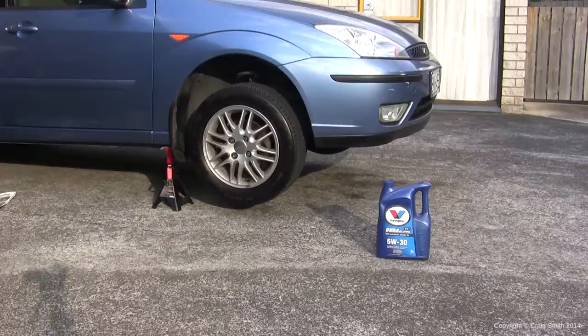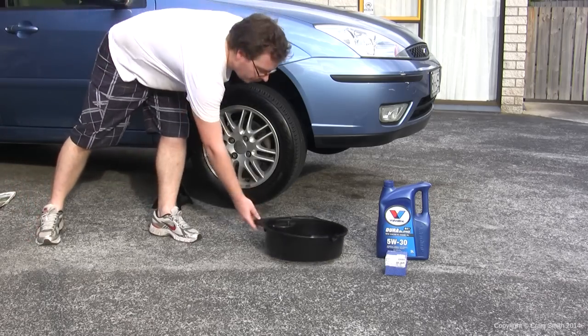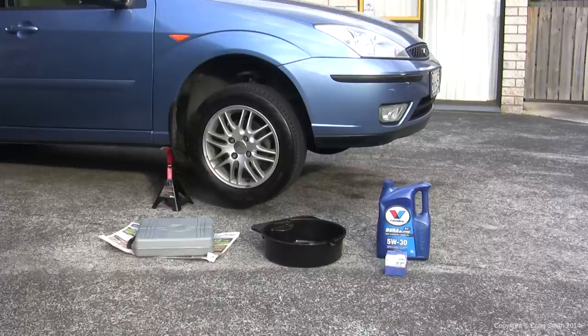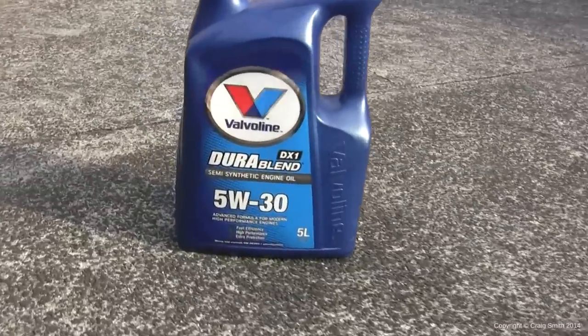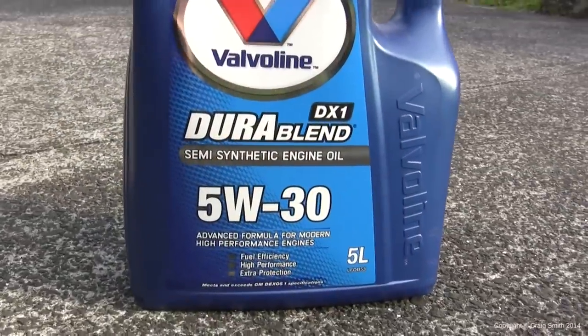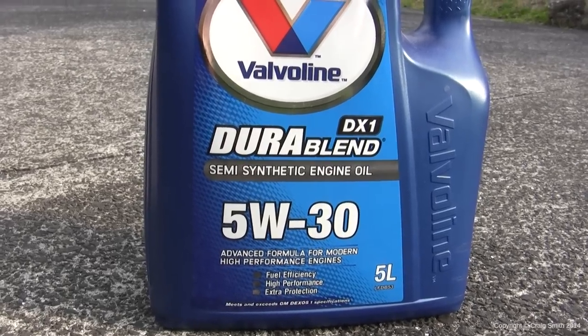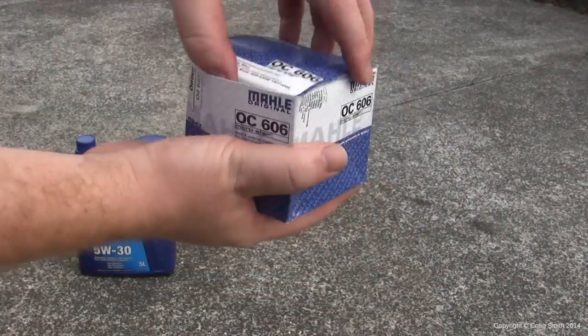You will need a Ford Focus. You will need new oil — four or five litres. You will need a replacement filter. You'll need an oil tray to catch all the old oil. You might need an oil filter wrench, although possibly not in this video — we're just going to do it by hand. The correct oil spec is 5w30 semi-synthetic. You can use full synthetic if you want, if it's not much more expensive. And obviously you need a replacement oil filter.